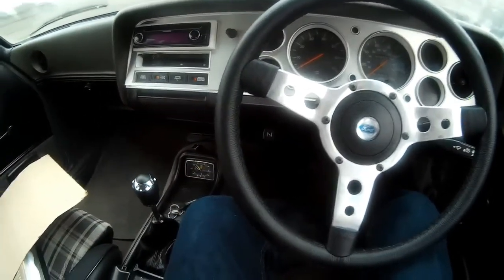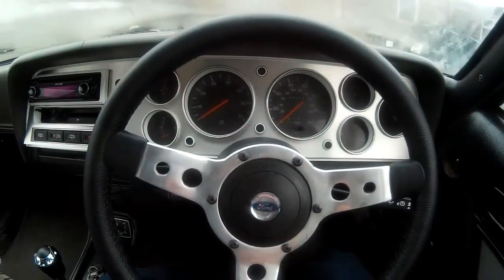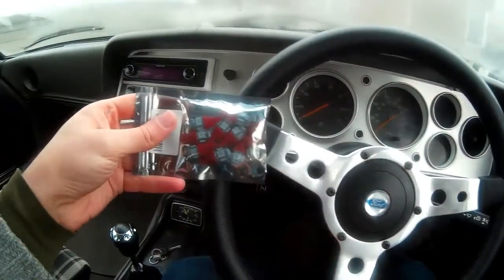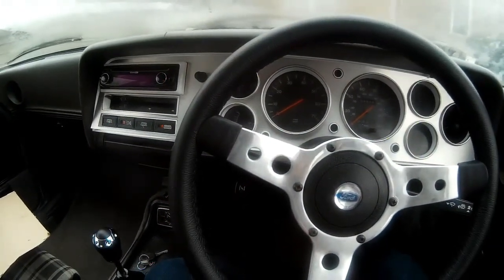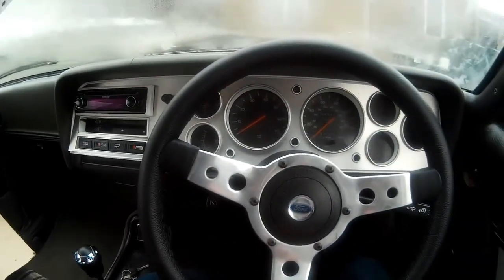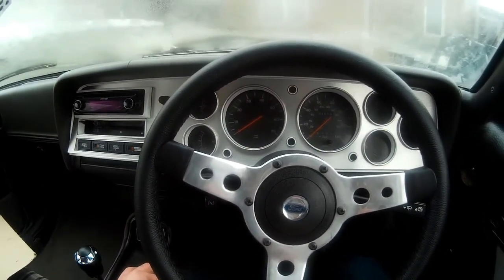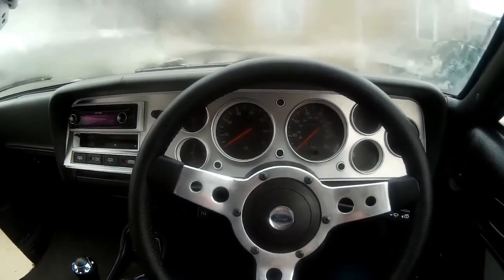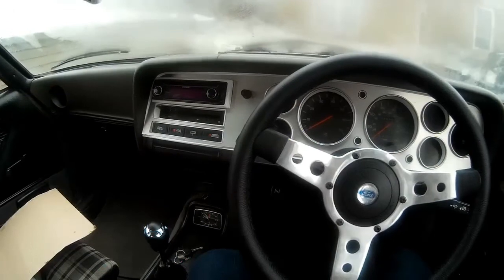A lot of these jobs are pretty common to the Capri. The lights behind the dashboard are completely dead now — I don't even get a tiny glow. I've bought some red LED lights which I'm going to try and fit in their place. Also, the heater blower motor doesn't seem to work whatsoever. I do get heat in the car, but I think that's just radiated from the engine through the bulkhead. I have to drive for about 5-10 minutes before the cabin heats up and the windscreen clears — driving with my head hanging out the window like a rabid dog, which is pretty dangerous.